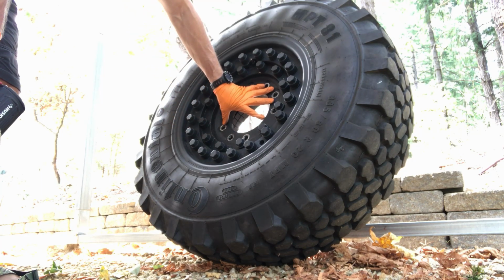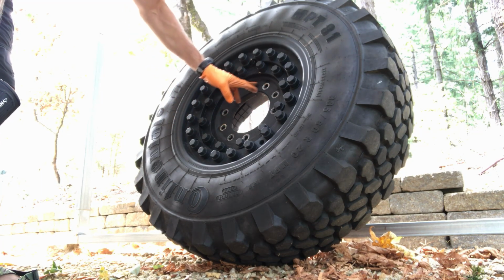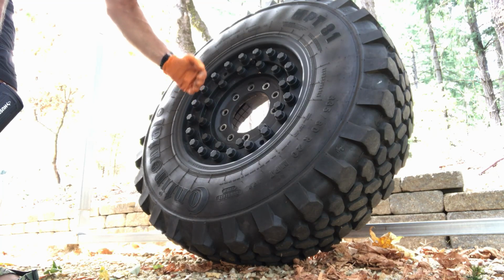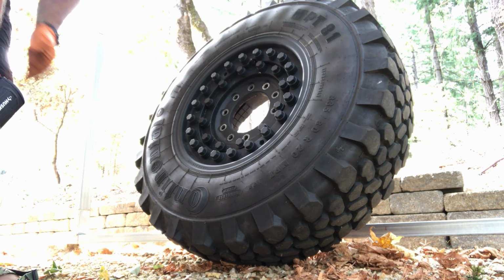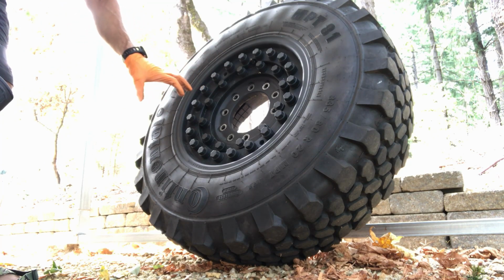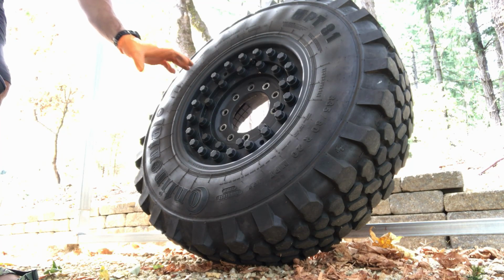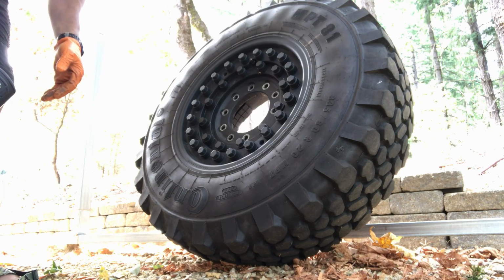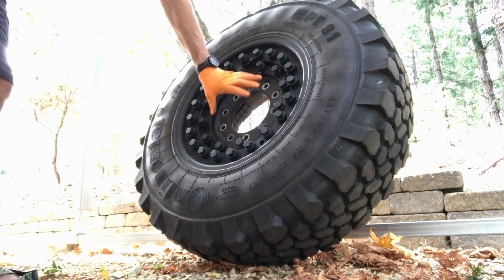That'll leave the spacer on the hub, and then go ahead and pull the spacer off, use it to mount the Centramatic balancer, and then remount the wheel back on. I think in order to get a good result and make sure that we press those balancers on correctly, this is the way we need to do it. But since I've already removed this wheel, I'm going to go ahead and take the spacer out from the middle here.